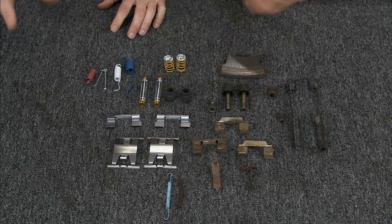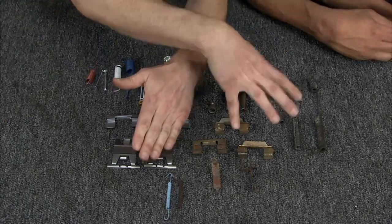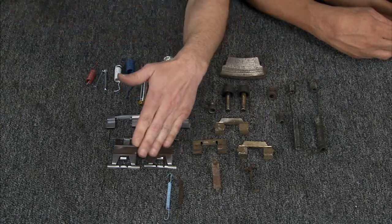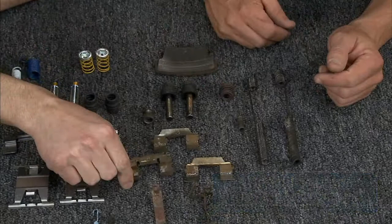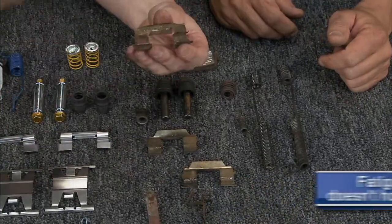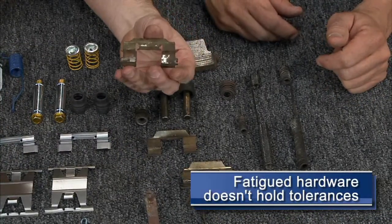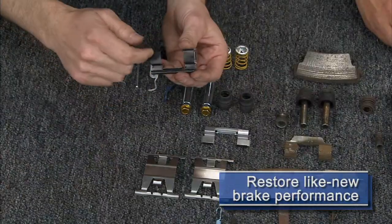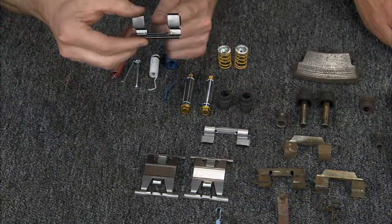If you've ever done a brake job, especially you shop guys know, you end up with a pile of all these little springs and clips and things, trying to keep them from shooting across the room while you're trying to remember exactly where they went. Well, this is old stuff. These are critical little pieces — whether it's the springs that fatigue, or especially these clips and sliders. They're not holding the same position and tolerances that they used to. And while you're at it, you get new stuff that's going to make your brakes just like they were from the factory. They've got upgrades like coatings on the backside, because this is where your pad is sliding against these surfaces.